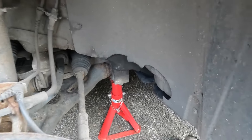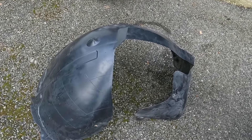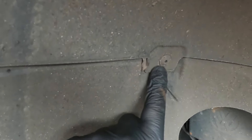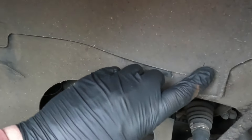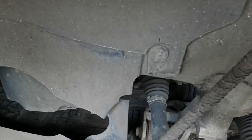Now I'm here to replace it. I got a new one online from a breakers yard and it was only about £18. It's held in place with a number of fixings — I think there were just two types: there's a T25 here and here, and various others dotted around, and there are also some plastic clips of the type where you remove the centre and then you can release the clip itself.